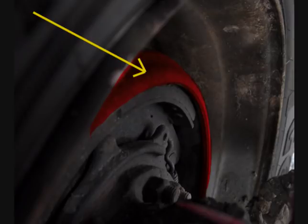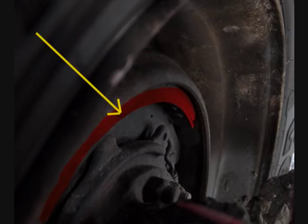Check the drums and linings to ensure there are no cracks, dents, or holes. It should be free of dirt, oil, or grease (D-O-G). There should be no cracks in the drum greater than one-half the friction area. The lining should not be worn thin — at least one-quarter inch of lining on shoes.